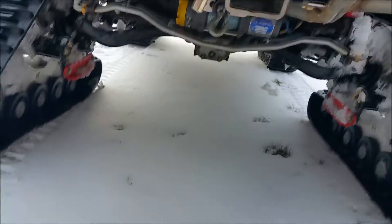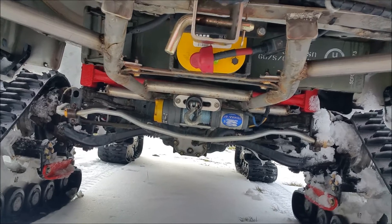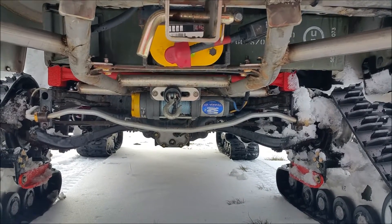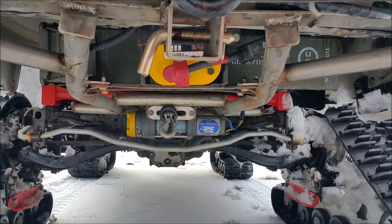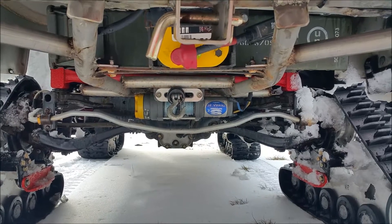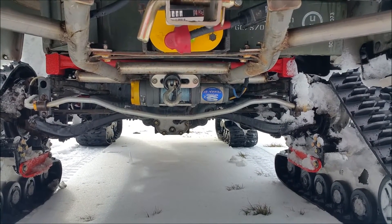The rear here is kind of different from any other Baja — I have a rear-mounted winch and a secondary battery for emergencies. There's a switch in the car connected to a battery isolator that lets you turn it on or off. If something gets left on in the car, this battery will stay fully charged because it's not connected to the other battery when the car is off.